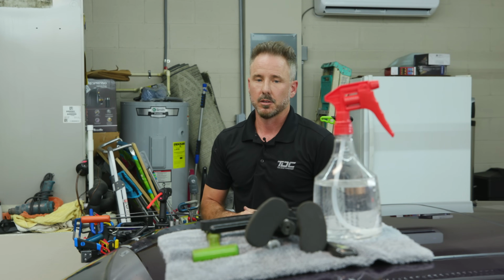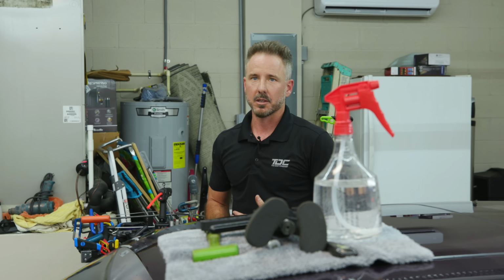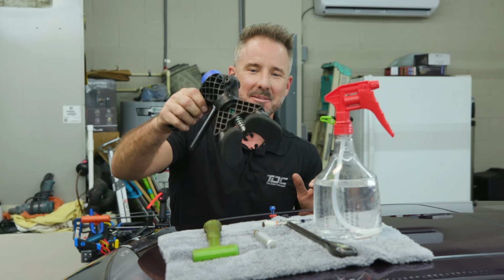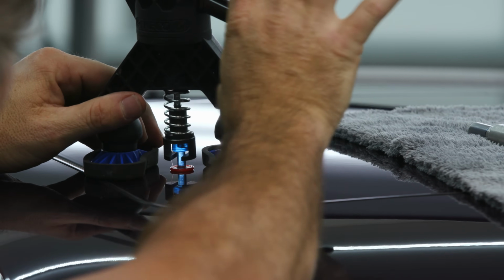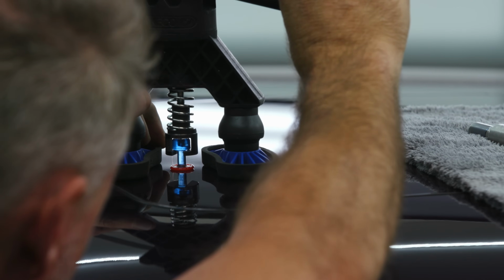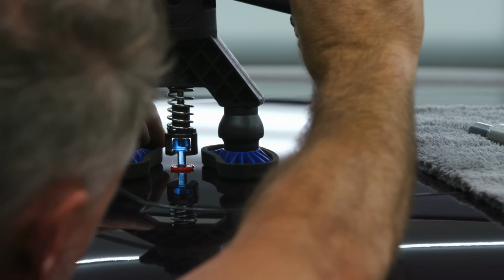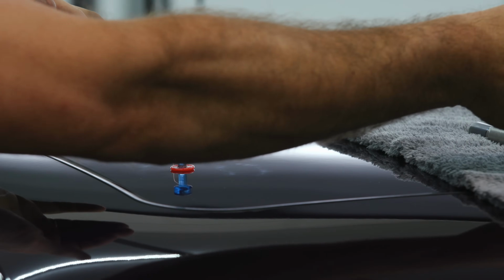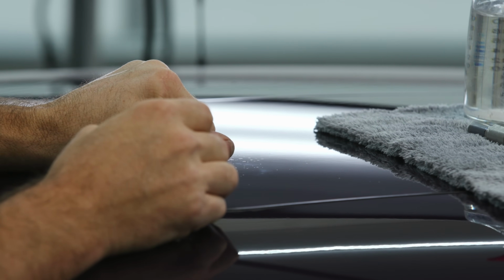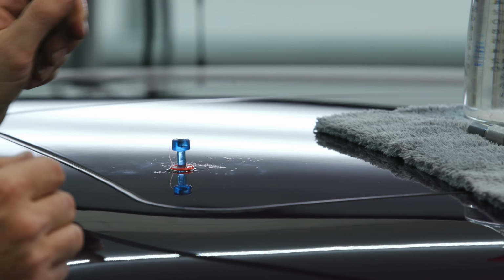Once you've done that, glue pulling seems so cool and easy, but you're blocking everything that paintless dent repair is about, which is vision based. Now, better hope I put it on right. Better hope I do a lot of things right here. So I'm going to look through here only because it's a sunroof frame. I know it's very soft, and I'm getting an idea of how hard I need to pull. The biggest mistake you could make is if you just came in here and squeezed this trigger as hard as you could. You probably could ruin the panel. I would say unrepairable no matter what. You can see how thin it is because I'm just barely doing that, and it's making it flex.